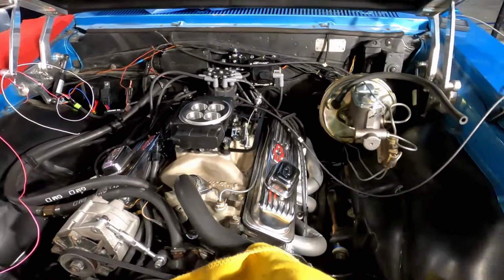Okay, so here's where I'm at. I've spent about another hour screwing with stuff for throttle linkage and whatnot. My kickdown cable is perfect, and it was making no sense to me that my throttle cable, if I got it to get a full 100% pull, it would release down to 40% and stay there. And vice versa, if I adjusted it all the way so the throttle blades were closed, full throttle would only get me about 60%.